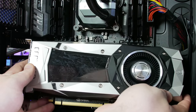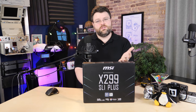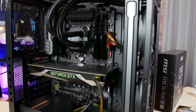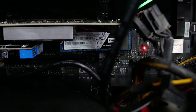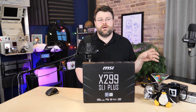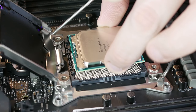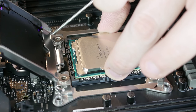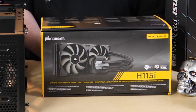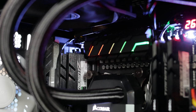We're going to be using a Founder's Edition GTX 1080, maybe a 1080 Ti depending on availability. You can get a really good deal on the 1080s — as cheap as $400 or $450. For storage, we're using a Western Digital 256GB SSD for now. Maybe I can combine a mechanical drive with Intel Optane for a really fast 4TB storage area. For the CPU, I'm using an Intel Core i9-7900X — the 10-core CPU. We'll see how that runs with the Corsair H115i in terms of power dissipation. We're also curious about heat production in the VRM area with this particular motherboard.